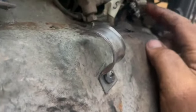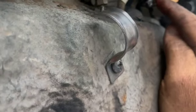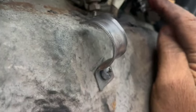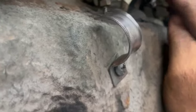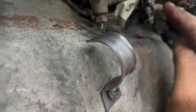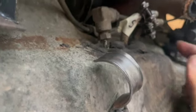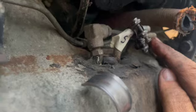But that's work we were doing today, and we have to stop because our fuel line was 6 millimeter, not 7 millimeter. I think the diameter on this is supposed to be 7. But I tell you what, guys, I'm looking at these and these are closer to 8. So I'm going to mic these one more time. I know it has to be tight going on and then you put your clamp and everything. The book called for 7 millimeter, but I'm thinking these are closer to 8. I don't know if S's and E's had 8 millimeter fuel lines, but the 5 fit fine on the spray and pray system, but these are a little big.